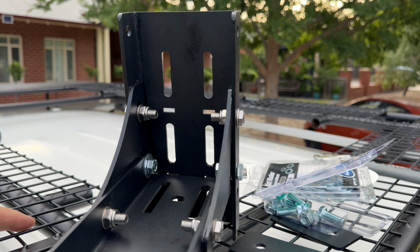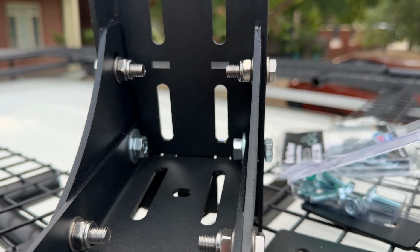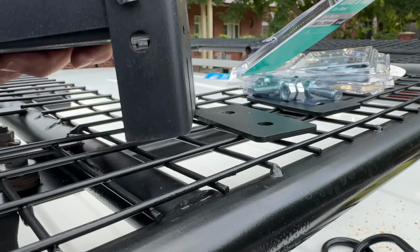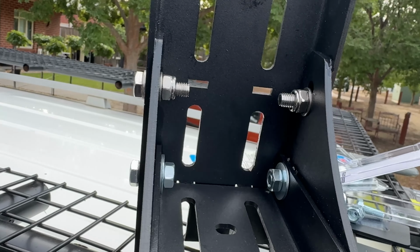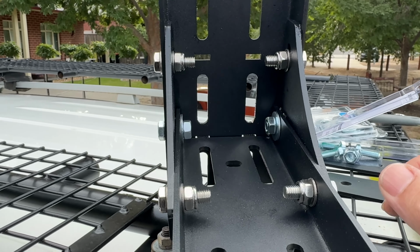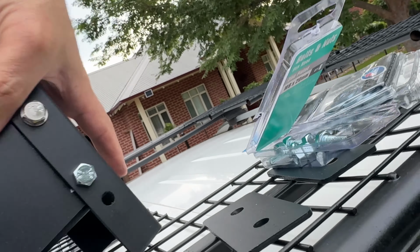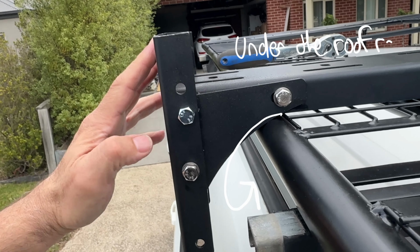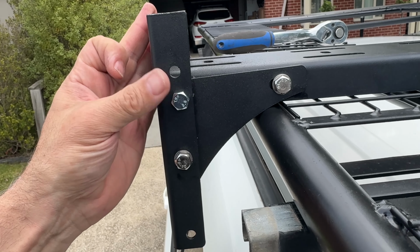All right, guys. So this is that extra bolt I was talking about. We'll put one on this side, one on this side. Now I won't tell you how much trouble I had drilling this damn hole. I went through so many drill bits. I did it on the drill press, and I ended up having to have it sent off to a friend to do. But that's the whole reason I needed that, because I'm mounting this in this position. And if I didn't have that bolt there, this would fold forward.